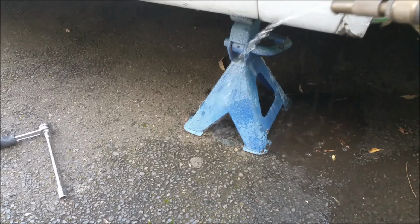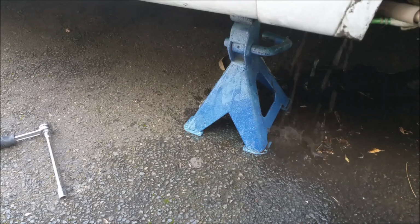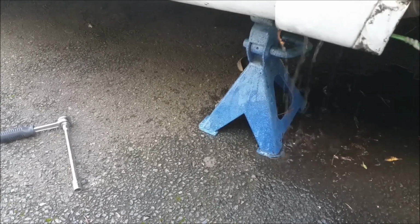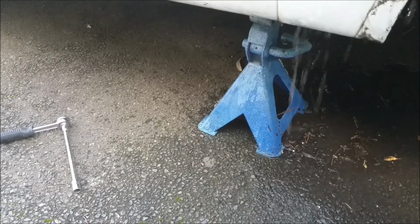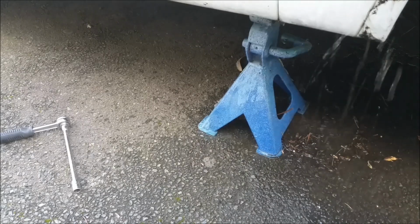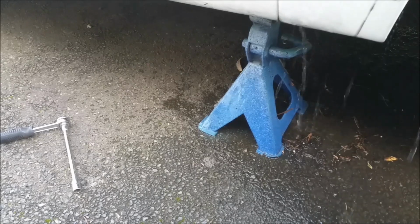It can take a minute to do this, it's not a big job, but it'll keep the thing in much better repair, and it's just all washing off, and you can see it looks lovely. There's a whole lot of the back there, you can see. People did this with their old Falcons, they would have lasted a lot better. I did it on the Corolla once, but the more modern cars are dipped, so you don't get the problems with them. But even all those years of stuff there will just come off, and we can just use a light bit of cutter on a rag, although that looks like it's been painted around there.